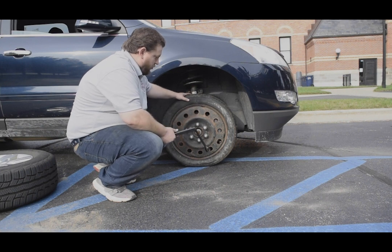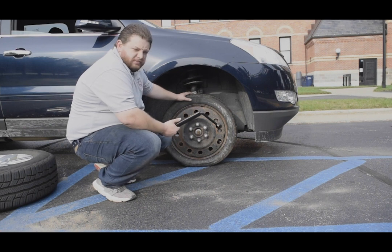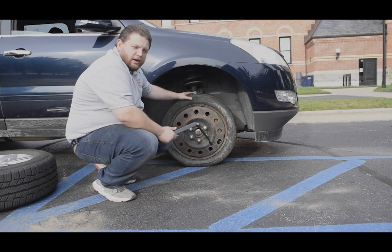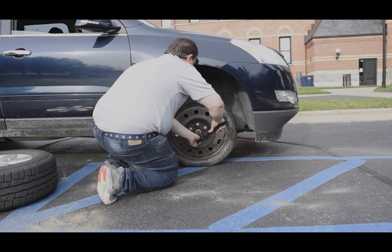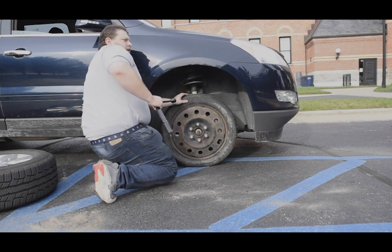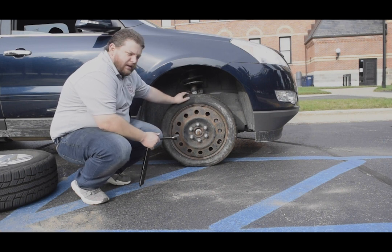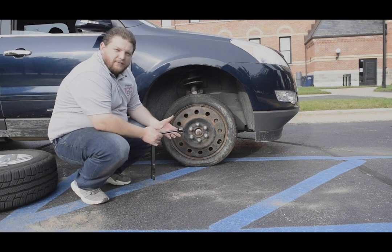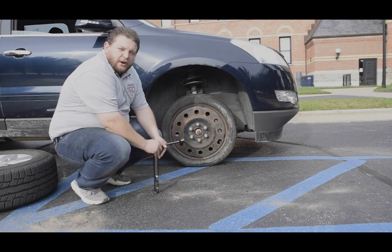It is important to note — this is a 2012 that we're working on — the spare tire air probably hasn't been checked for a year or two, but it still has air in it. You should try at least once a year to have your air pressure checked in your spare tire. Now that you have your lug nuts tightened and you're safe to go, make sure you load up all the tools and don't leave anything behind. Then you're ready to take it to a tire store to have your tire inspected.